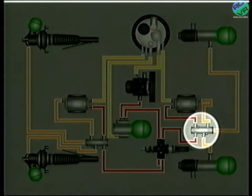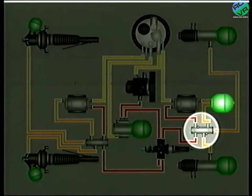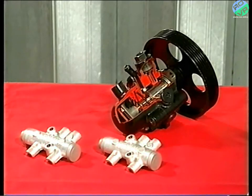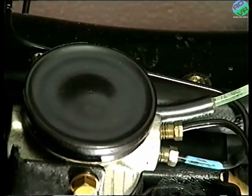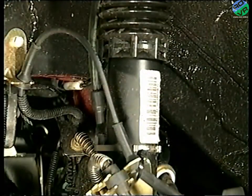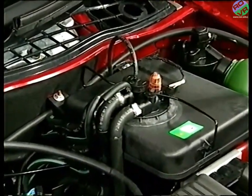So to avoid such a problem, an additional sphere is fitted. It acts as a rear brake accumulator to supply the brake control valve. A simple way of knowing if the car has anti-sinking valves is to look at the pump — if it's a 6 plus 2 pump, then you can be sure it will also be fitted with anti-sinking valves and a rear brake accumulator. And one final point to note: a controlled leakage, aiding lubrication, will always occur naturally within the various components. This fluid is returned to the reservoir via a network of return pipes.